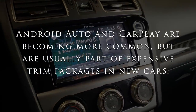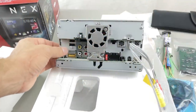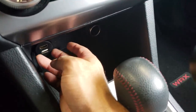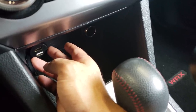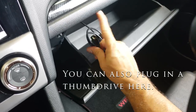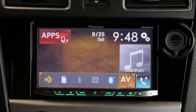One of the absolute must-have features for me when shopping for a stereo was the ability to use Android Auto and Apple CarPlay, and this stereo supports both. It has two USB ports in the back — one supports Android Auto and the other supports Apple CarPlay. I connected an adapter to the HDMI port for easy access to the USB port that supports Android Auto since I have an Android phone. For Apple CarPlay, I put that connection in the glove box since I rarely use it, so whenever someone with an iPhone gets in they can just open the glove box and connect.